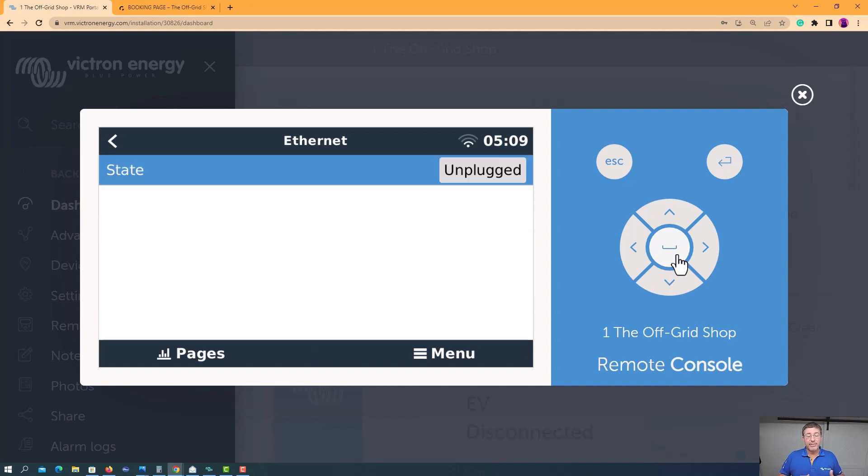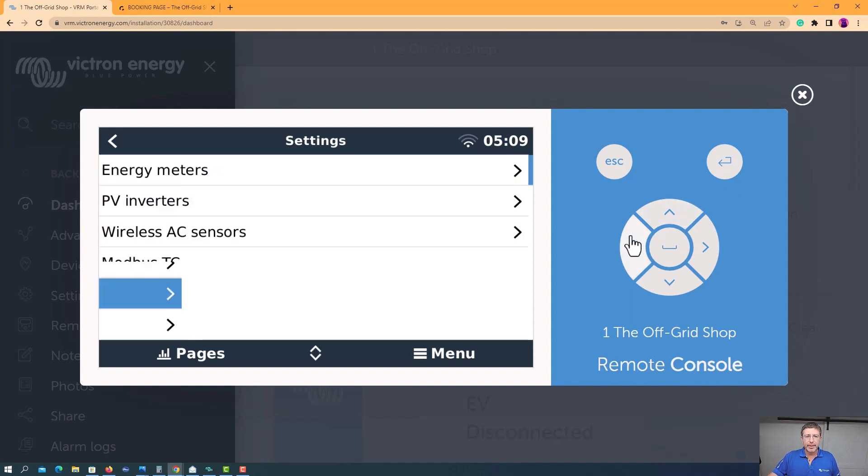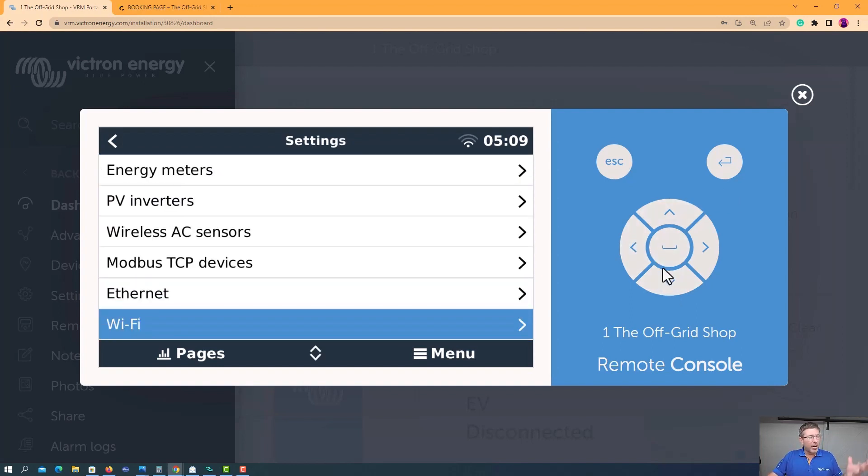If you log in here and go to Ethernet connected and it says unplugged but you've got something plugged in, there could be an issue on your end with your internet. The way I think about it is: go get your laptop, turn off your Wi-Fi, and plug your laptop into it. I know it's really hard with a Mac because they don't have an Ethernet connection, but plug something else in and double check. Most of the time it's a cable connection issue on your end. But if you've got Ethernet, I'd highly recommend you use it. Most people use Wi-Fi though — I use Wi-Fi, mine's pretty reliable, and I've got a modem right next to it.